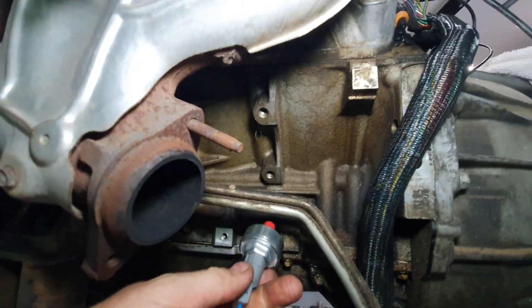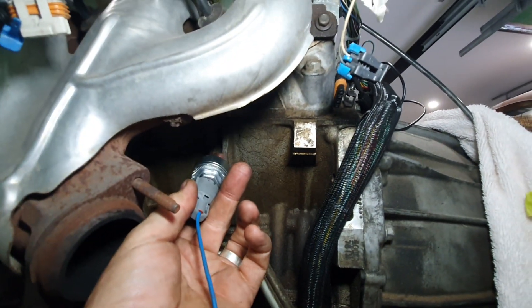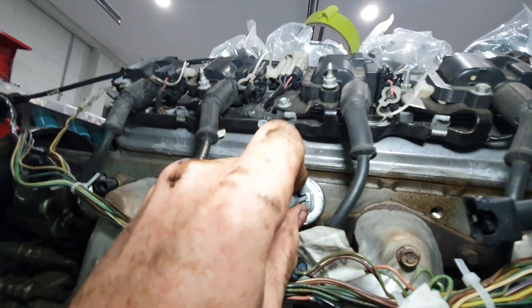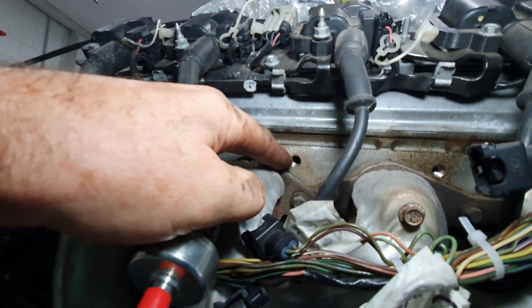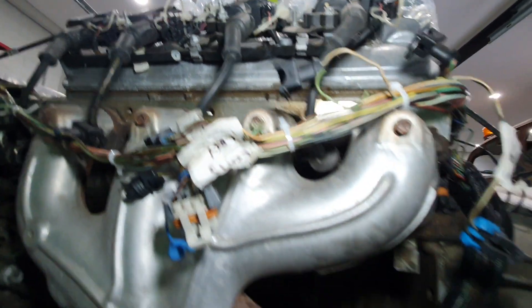A lot of people screw them in here, but if you screw it in here you get a lot of detonation sound from cylinders firing. A lot of people screw them in the top up here too, which is a big no-no. You can see how close that is to the exhaust manifold or exhaust headers — imagine the heat that knock sensor would get. It wouldn't last very long.